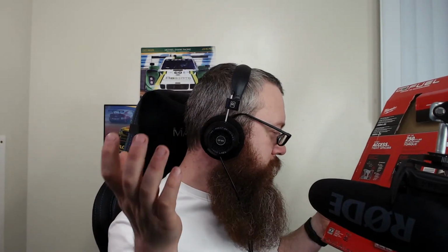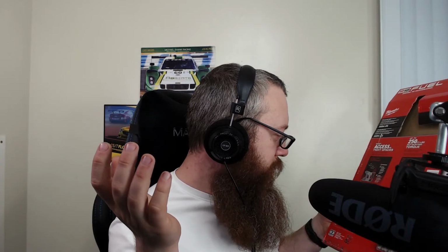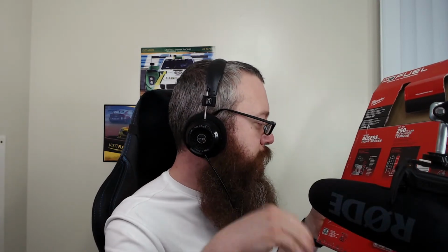Okay. So there's actually 3 settings on this thing, and your 4th setting, quote unquote, is your nut busting torque, which in both 3 and 4 is 250 foot-pound. It actually states on the back side of here, so really I'm not sure what the point of that 4th setting is. And if you're even asking about the impacts, the first setting is 0 to 1000, you have 0 to 2400 on the second, and then both 3 and 4 are 0 to 3500. So I'm not sure what that 4th nut busting torque setting is even for.